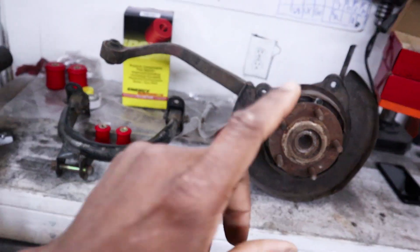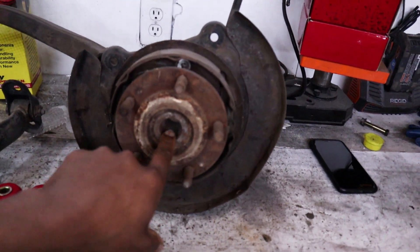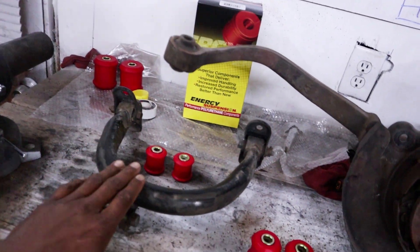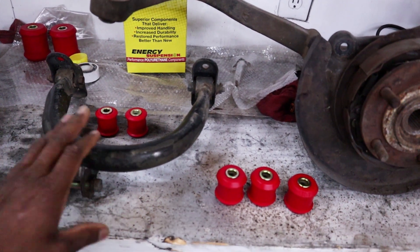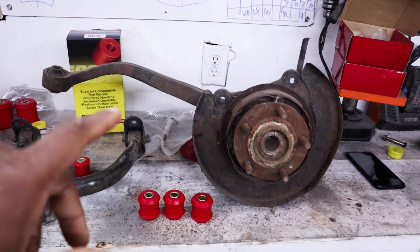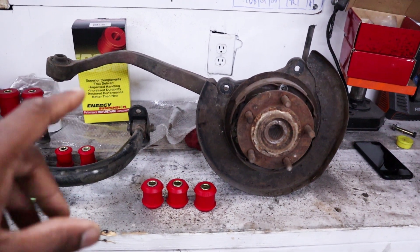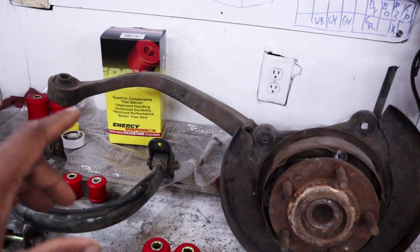It's to save me the headache and a good opportunity to learn. What I have here is the rear knuckle from a GSX — it has the spot for the axle and the upper control arm. The upper control arm between the four-cylinder and six-cylinder are actually the same, so it doesn't matter. The rear suspension of the Galant Eclipse third gen is actually based off the second gen, so this kit for the third gen will fit both of these.